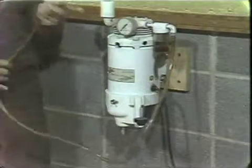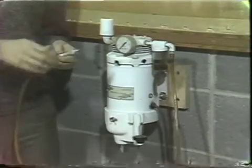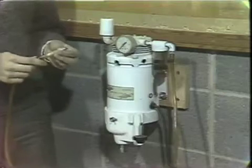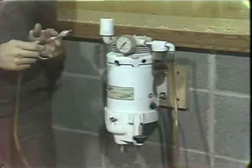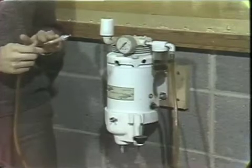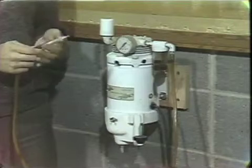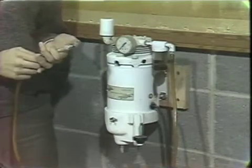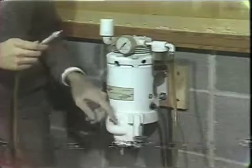The machine itself must be tested for a vacuum to be sure that the vacuum hose is not clogged. To do this, we turn the machine on and with no restriction of the hose, the gauge should read 10. When I place my finger over the hose, the gauge should go up to 30. I will demonstrate this.